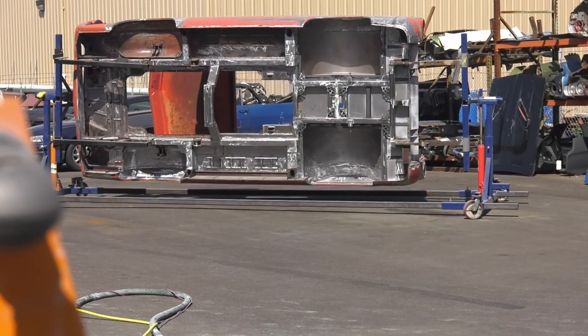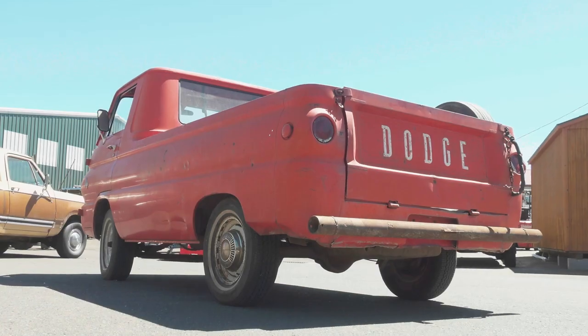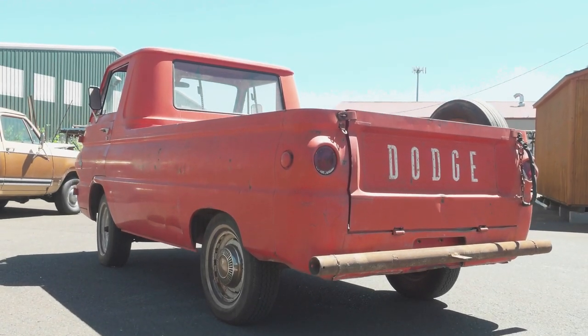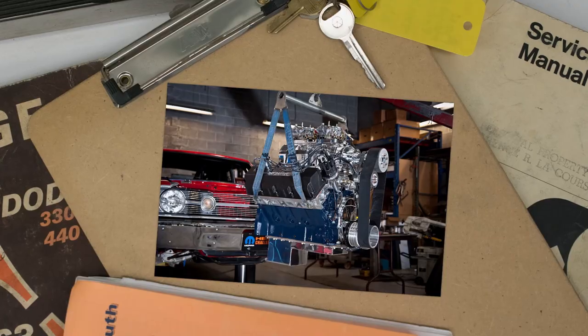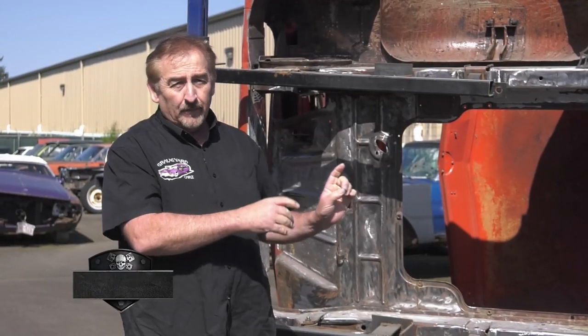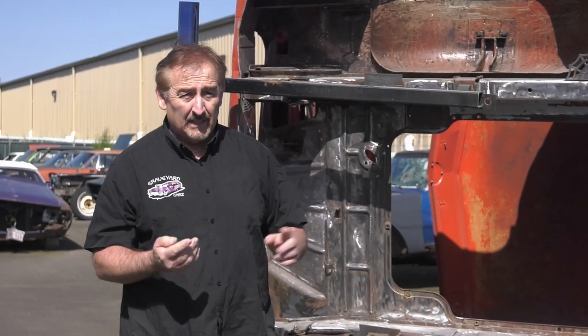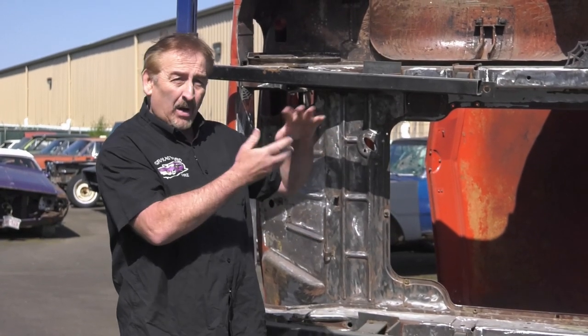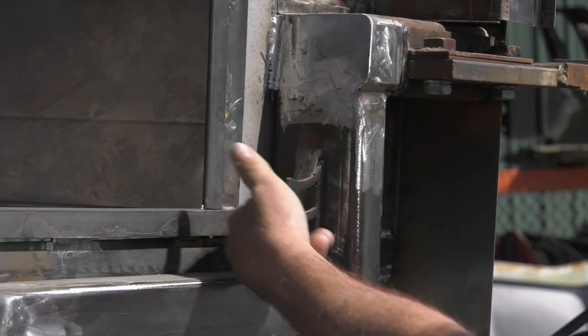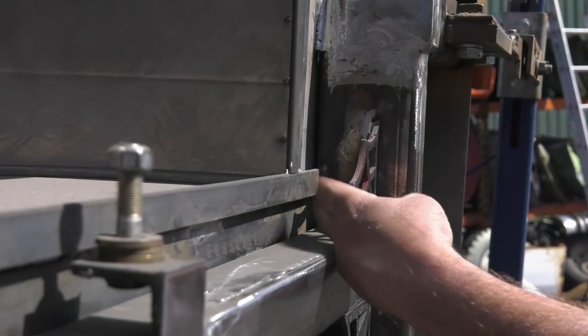So today, what we're doing is we've got the 64 Dodge A100 outside. This is our SEMA build vehicle — we're taking this down to SEMA 2018. This is the one that's getting the Ray Barton built Mopar Performance Block 426 Hemi. We've been waiting for the sun to come out so that we'd be in a position to do some soda blasting. Normally we dip these vehicles, but in this case it's too tall for the dip tank, and it has a lot of boxed-in channels that we may not be able to fully neutralize.